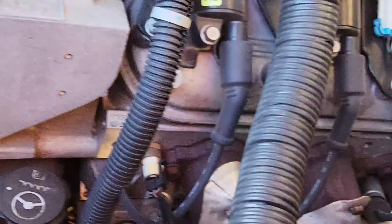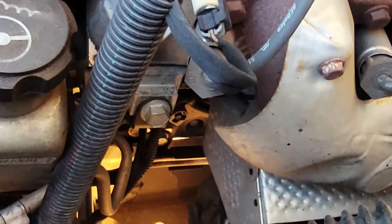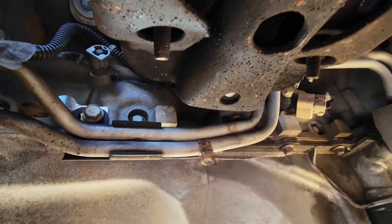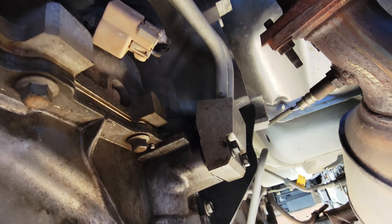So we're going to go ahead and replace this line today. I'll show you what I'm talking about with the leak looking kind of suspicious — it's just hard to tell where it's coming from. Once I zeroed in on this oil cooler line block, I was thinking it was leaking out of the hard lines coming out of the top, but that's not it. To do this job we're going to have to remove two bolts and cut the lines on the old unit to remove it, and we'll have to replace both these hard lines into the radiator where it goes into the cooler.